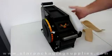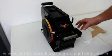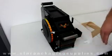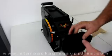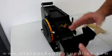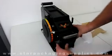The only maintenance on a machine like this — what we recommend is cleaning the brushes every once in a while. Depending on the mineral content of your water, you'll start to see a build-up on the brushes. Basically pop that out, take this whole thing to the sink, wash out your reservoir and wash those brushes with some warm soapy water. Pop that back in.